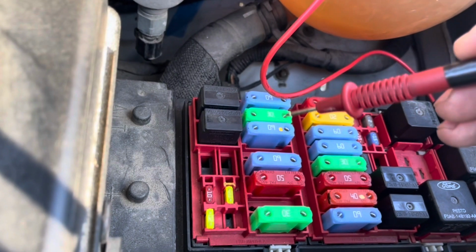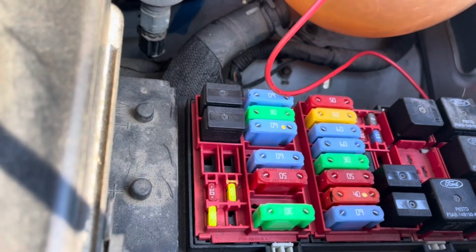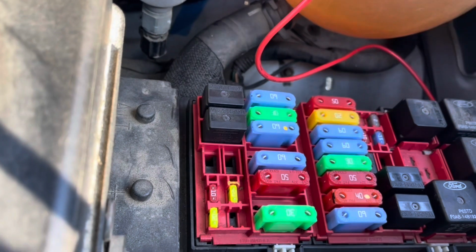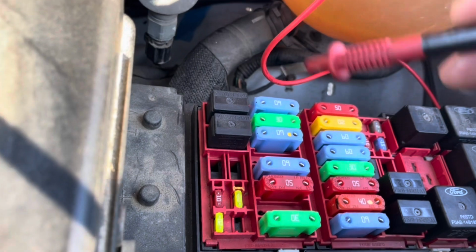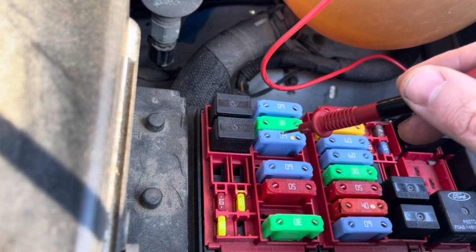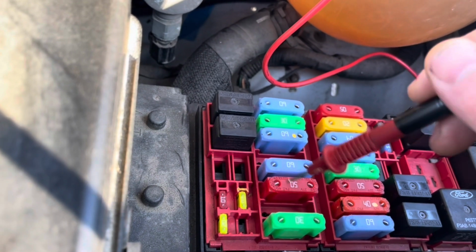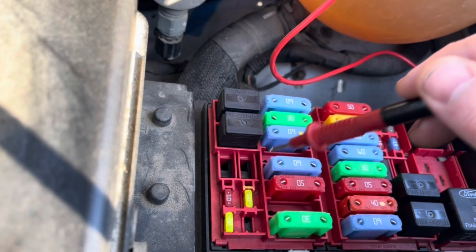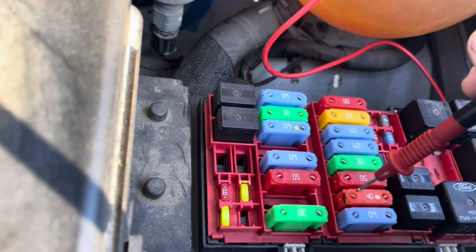So that's where the red and yellow wire comes. It goes to this fuse, and it goes to this one. This is a trailer charging relay. This is the fuse that's going to protect circuitry for all running lights. This here is the one that gets paired up at the solenoid with the main battery power. It gets combined with auxiliary battery power. So running, these should all be the same. There shouldn't be any voltage difference between the two.